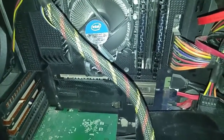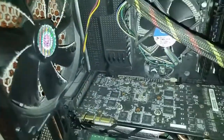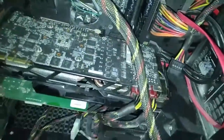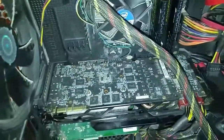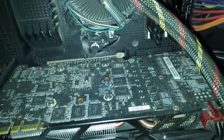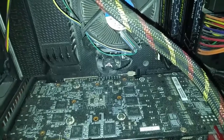Let's get that card in and do that test. This is with the graphics card in, plugged in, got power plugged into the motherboard. This other thing down here is just an internal capture card. Got power set up to the rest of it. Turning it on — one, two, three, four, five, six. So that's the six-beep error I was referring to when I made my note.